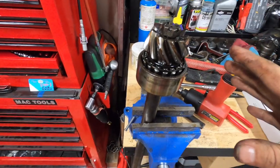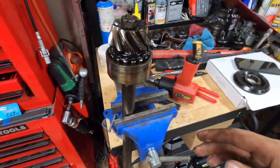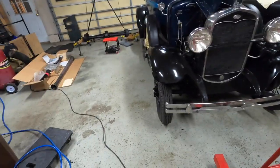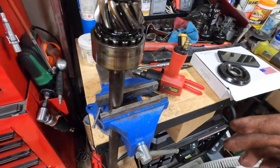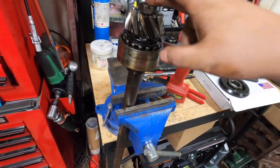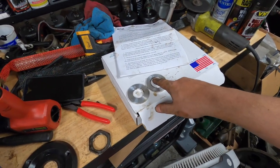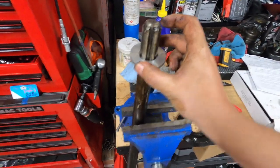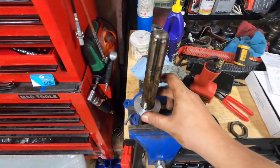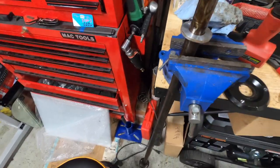Next we're going to flip this whole assembly upside down. We'll put the nut back on just to protect the threads, then use the torque tube laying on the floor as a big giant slide hammer to bash this whole assembly off the end. Included with your kit you'll find two thread protectors — one marked 'MA' for Model A, one marked 'MM' for Mitchell Manufacturing. The Model A one slides right over the diameter of the original driveshaft and will sit above the threads we took those giant nuts off of, protecting them while we knock the bottom end loose.